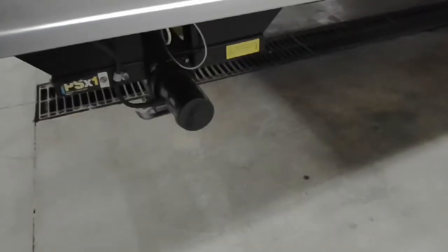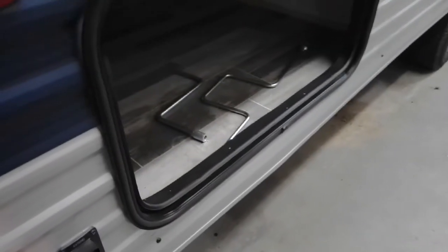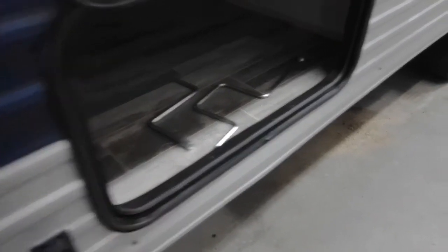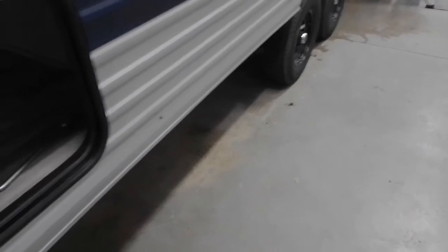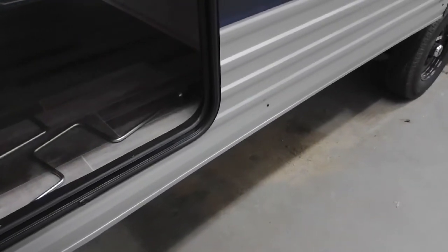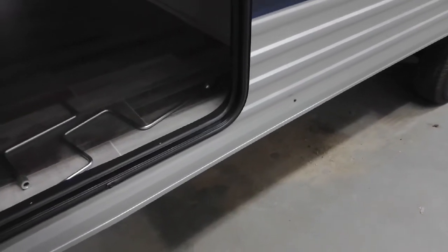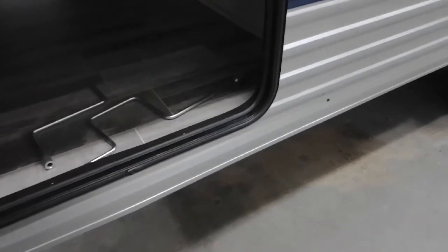Your stabilizing jack switch is here. Sometimes one leg comes down and touches and then the other one will. They're not going to apply any pressure until they're evenly touching the ground. They're not meant to lift the camper — they're stabilizing. When you back this into your campsite, you'll use your wheels to get your side-to-side level by laying blocking down on whatever side's low, back onto the blocking to get level, and then use your tongue jack to get your front-to-back level. Once you're set, then these go down at the end just to stabilize it.